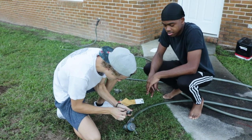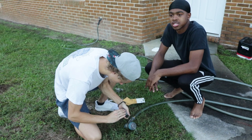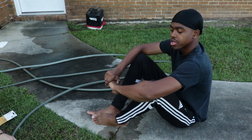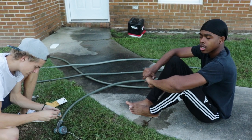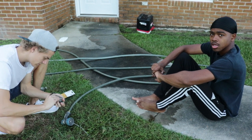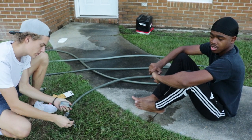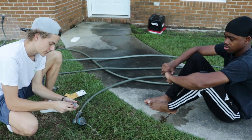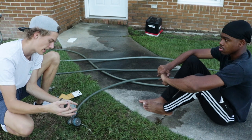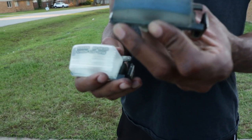After he's done polishing, you'll see how it looks before and after. We are using 1000 grit to get this stuff off. I wouldn't recommend going any lower than that. Mine is a special case because of the paint, so it's taking a little longer, but most of it's coming off. If you really want to explore going lower, don't go below 600. Always sand wet, not dry. If you do go 600, step it up to 800, then 1000, then 1500, and then you're ready to polish.